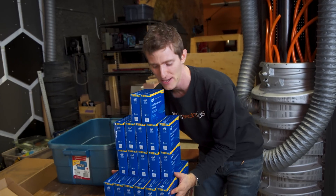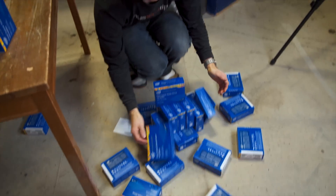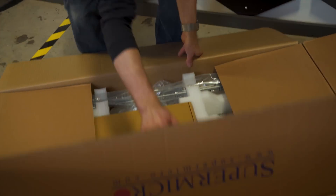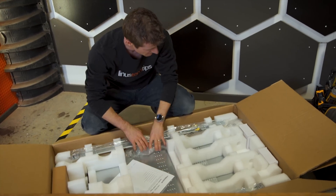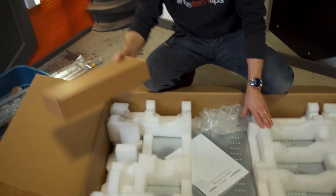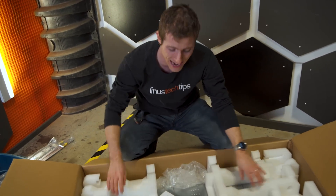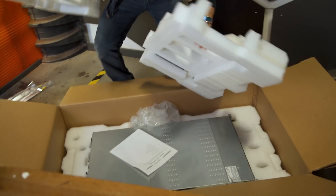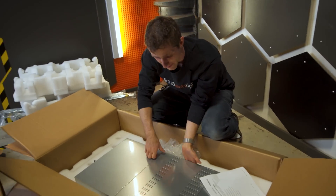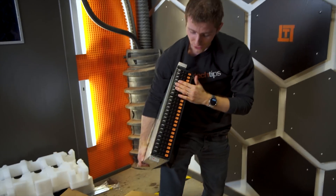We are going to put them all in a gigantic RAID array. But how on earth do you run NVMe drives in RAID? The answer is this very special bare-bones machine from Supermicro. This box can handle not just 24 but 48 NVMe drives, giving us the capacity to have up to about 50 terabytes of solid state storage in a single box — and it's all in a 2U form factor.